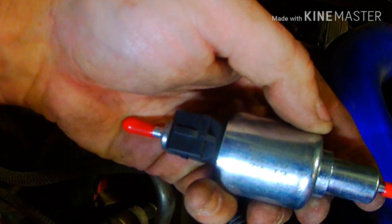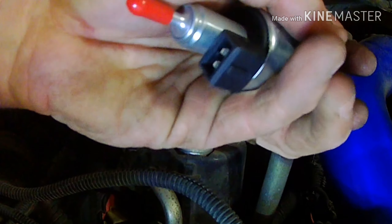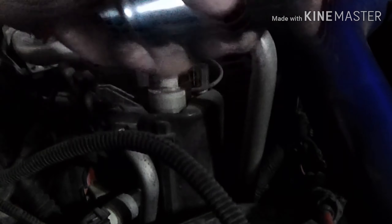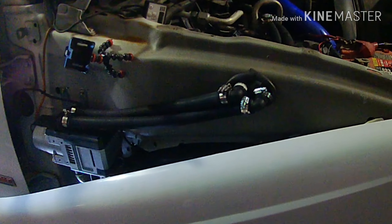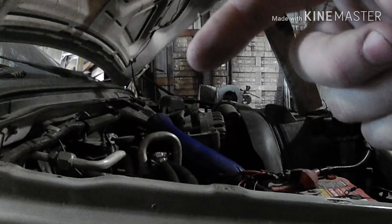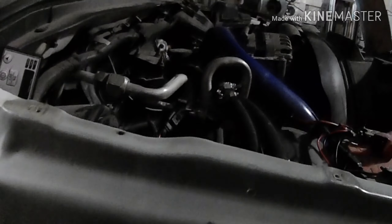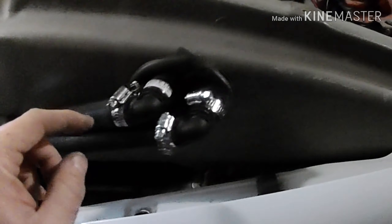The circulation pump is a YG-19-32-12 and there are no arrows indicating flow direction on it. I've got a few extra low-pressure electric pumps anyway — I'll plug it up and see which way it pumps. I'll do another video when it gets closer to being done. With everything about done, I should have paid more attention because the degas bottle is almost at the same height as these hoses. Therefore I can leave the return hose up high, no problem, but the hose with the pump needs to go down and get as low as possible underneath the degas bottle.